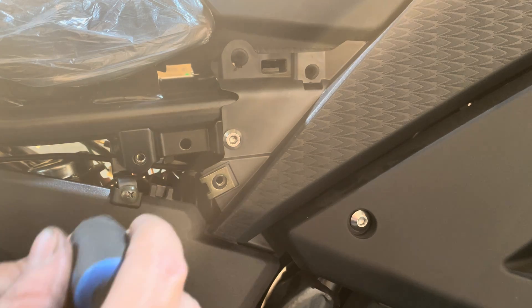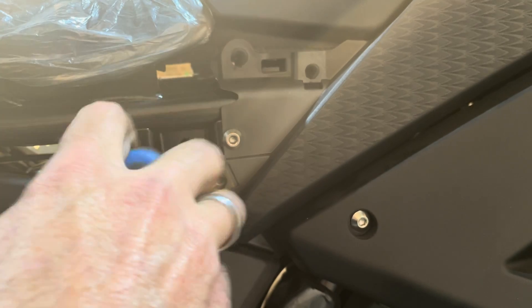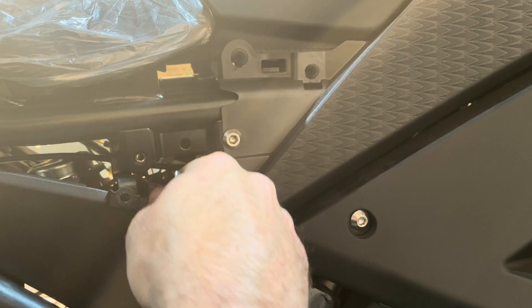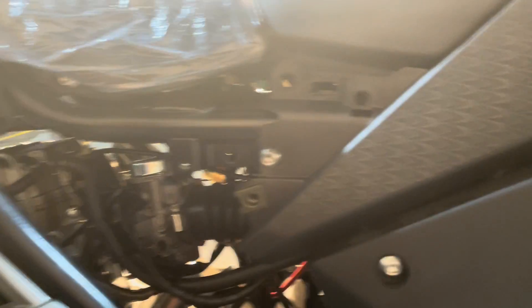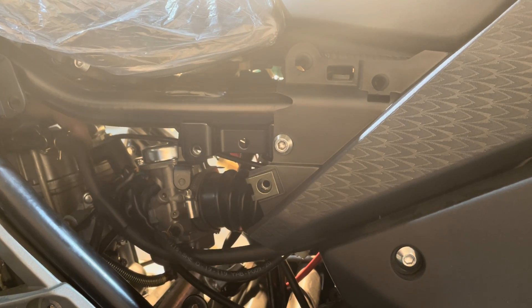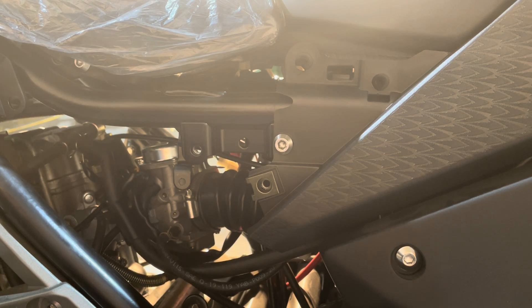This fairing is just going to — put your fingers underneath and pull towards you. This one down here has got the Phillips screw. I'll probably remove this one. It won't give us a whole lot of access but it does show us a little bit more when it comes to the lines. So these lines here are just the breather lines. They just come off the emissions.